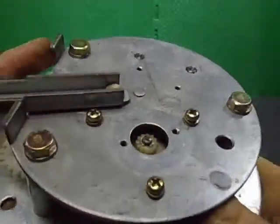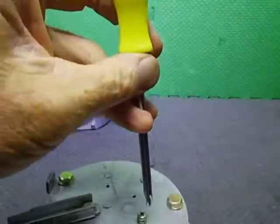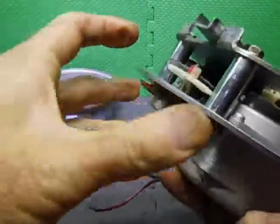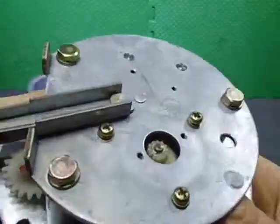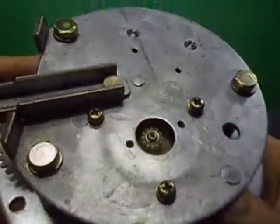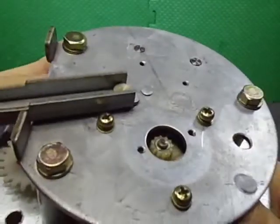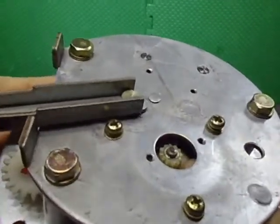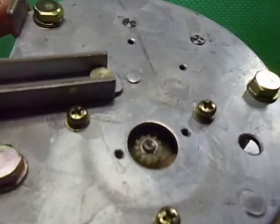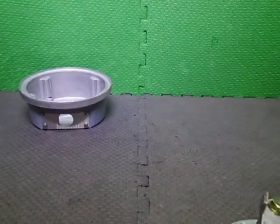It looks like too much backlash, so I can actually move the motor across a bit. I'll nip these up a bit more because they're just a little bit loose. I grab hold of the number one gear, hold the pinion gear with my thumb and just watch - no, I've got too much backlash, need to go back the other way a bit. No backlash - it was as tight as... yeah, I've just gone too far. Just went a little bit back. There we go - I'll leave it there.